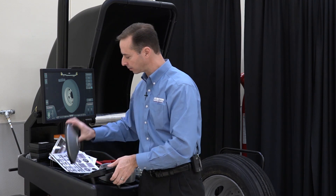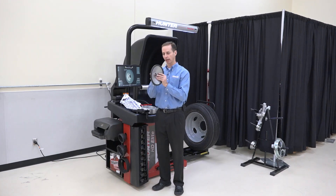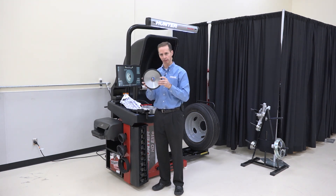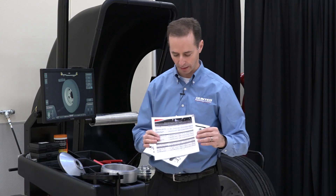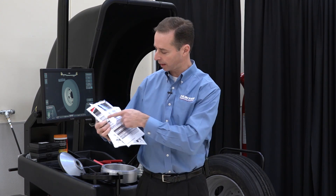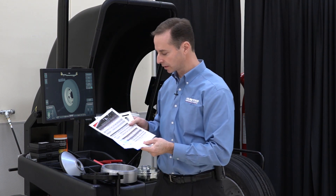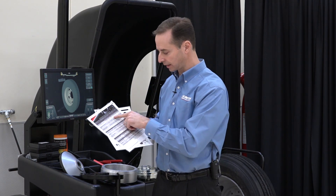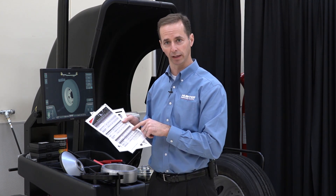Alternatively, your kit may have come with the nine-inch cup. In this case, this would push from the outside of the wheel and would be used instead of the flange plate, which is perfectly acceptable. Another part of this kit is the application guide, and this is a critical piece because it's going to allow us to look up the vehicle and assembly we're dealing with, and it's going to tell us which disc or collet we need and which bolt pattern we're dealing with.